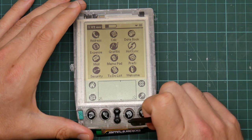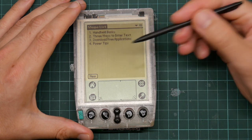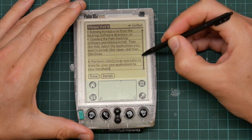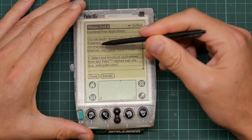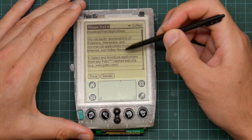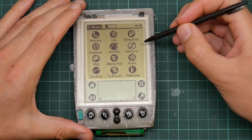There are no documents because there is no file system. This is the memo pad, and here are four memos. The only thing that knows about memos is the memo pad itself. They're actually stored internally as four different databases, which the sync tool knows about. So when you sync it to your PC, these will actually show up on your PC as individual text files integrated into whatever memo thing you're using, if the hot sync software understood it. And likewise, you edit the text files and sync them back onto the device as databases. Applications are also a kind of database and can be synced in exactly the same way.